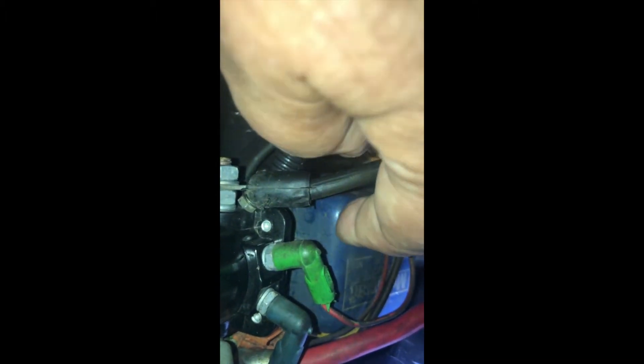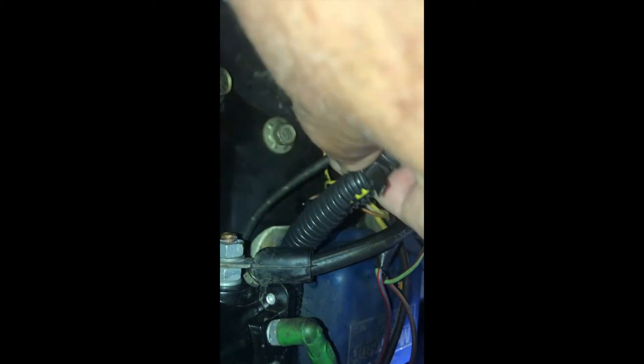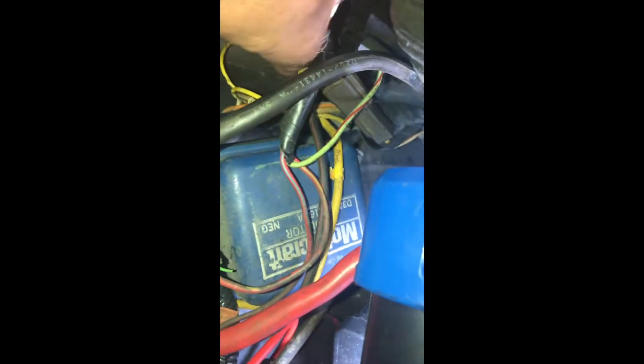These wires go down to a wiring harness right here. That harness is bolted to a ground stud on the back of the alternator, and then it runs up and over to the voltage regulator. The original units typically had a blue cover; the newer ones are flatter with a silver or metal cover. The wiring gets plugged into a four-prong terminal, which is not hard to get out but can be a little tricky because there are so many wires down there.